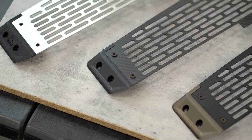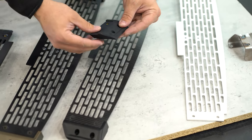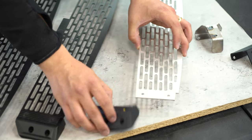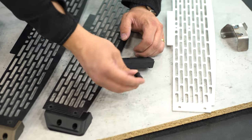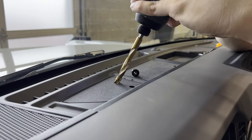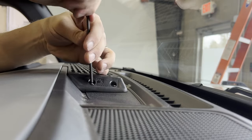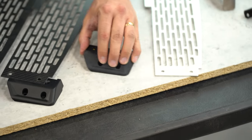These are prototype end pieces. We decided early on to do a multi-piece design where the top plate would be one piece and then there would be feet made from a material that would make it look like a really OEM part. This early prototype was 3D printed with brass inserts set in, so the top plate and this piece bolt together. These pieces mount to the dash using a well nut — you drill a hole in the dash trim piece, put the rubber gasket through, and when you tighten a bolt into it, it cinches up against the bottom of that panel. It's not going anywhere and provides a really sturdy mount.